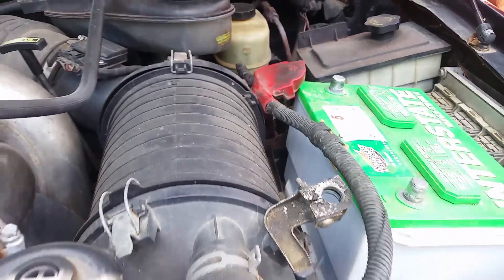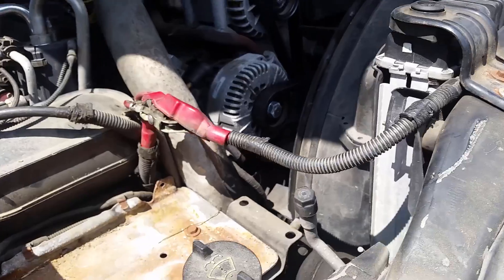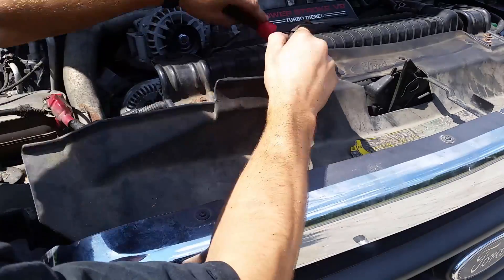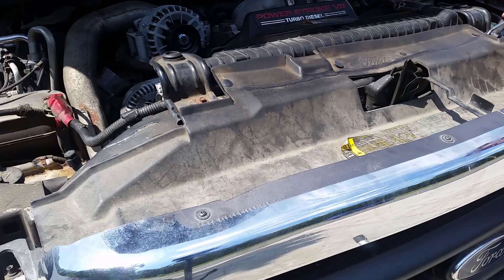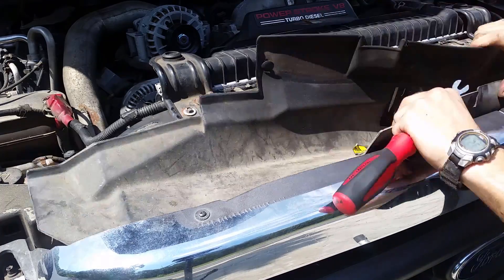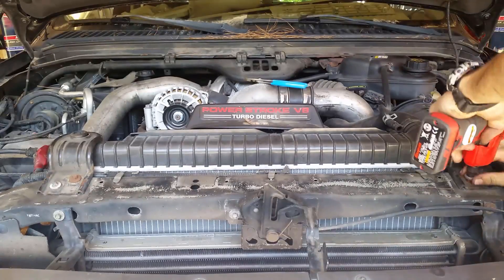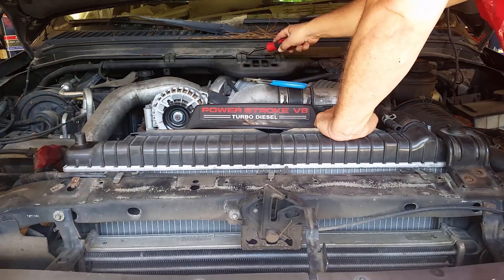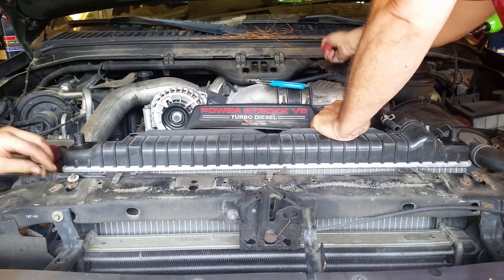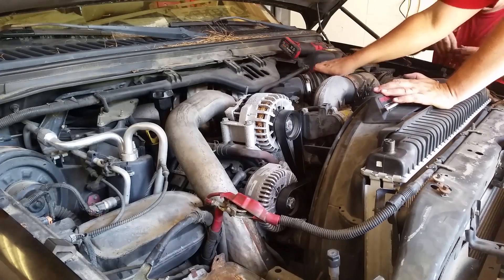You're going to want to remove all these little hoses on top. I have the batteries removed now — you're going to want to remove both of them after you're done with your seats because you need to slide them back and forth to get your bolts out. Go ahead and remove the little shield on top so we can get to our stuff down below. Then go ahead and remove the radiator mounts on top — two bolts holding each one. Put the bolts back in place so you don't lose them; try to put as many bolts back in place as you can.